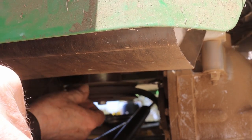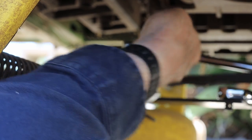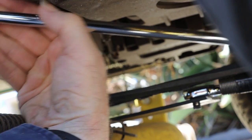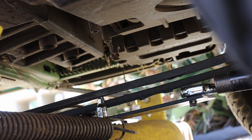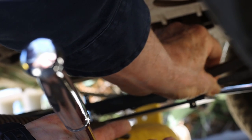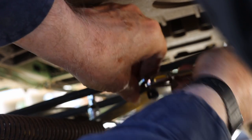Remove the cheater bars. The really strong spring will slam one of the ratchets against the stops. The top ratchet was loose, so I pressed the release button and popped it off. The pipe plug socket stayed with it. I used this to turn the 3/8-inch square bar from the bottom to release tension on the other ratchet. It is easy to move the ratchet direction switch to loosen. Note the spring pulled the bar toward you. You can then pop out the other ratchet and remove the belt installation tool.